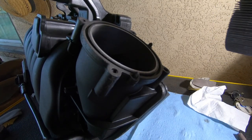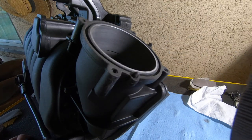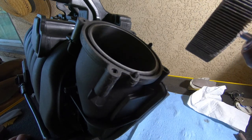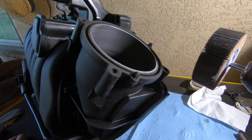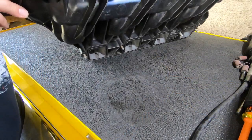The problem I had with the electric die grinder was that it was going too fast and melting the plastic, so instead of removing material consistently it was just burning a hole in the side. I stopped using it right away. Whatever tool you use, make sure it's running at a slower speed so you take off the material slowly but consistently — that makes for a much better porting job.